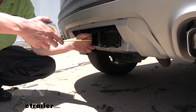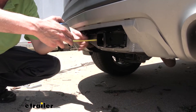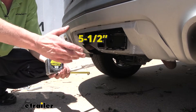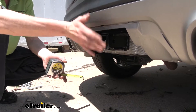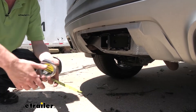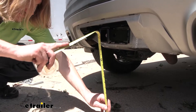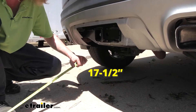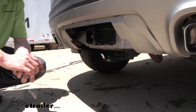I've got some measurements to help you when deciding on accessories. From the center of our hitch pin hole to the edge of our rear bumper, we're right at about five and a half inches — important when determining if your accessories can be inserted without contacting the bumper, or placed in the upright storage position. From the ground to the top inside edge of our receiver tube, we're right at about 17 and a half inches, which is important when determining if you need a drop, rise, or raised shank on your accessories.